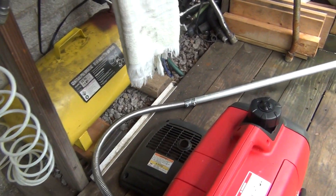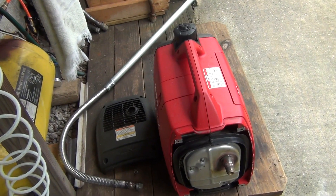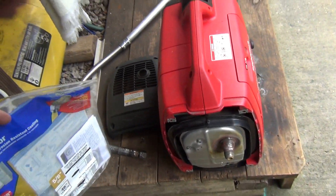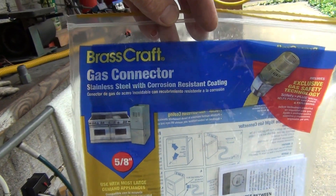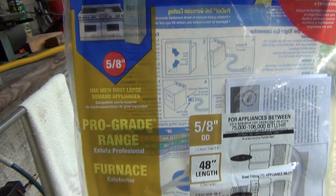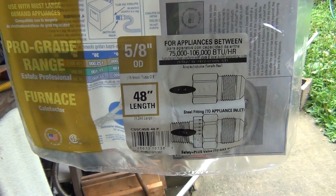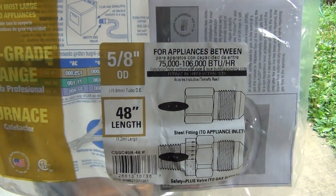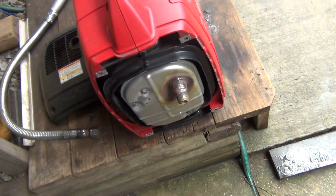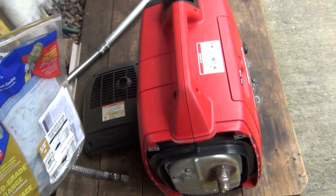What I've done here is install a muffler coupling and muffler pipe, which I'm going to run out of the cabin. I purchased this at Home Depot — it's a connection kit for a stove or gas furnace. It's actually 5/8 inch OD, which is probably the best size because it's a little bit larger than the exhaust outlet from the muffler. You do want to go larger; you don't want to go smaller — you don't want to choke it.